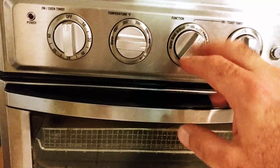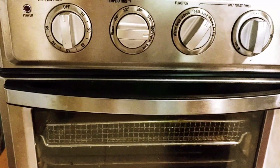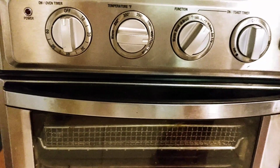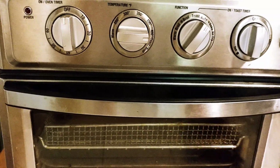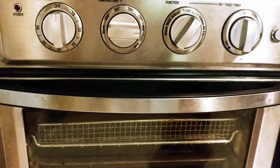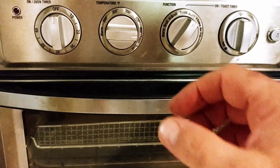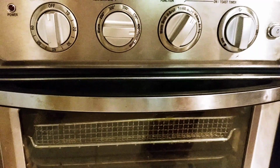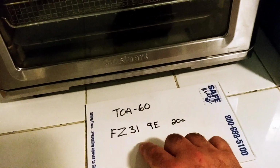All the other switches in here visually looked a lot more robust than the switch that works this. So there's two switches in a row here, actually, two identical switches. And I took the ball detent out of the broken one. You can tell that the ball detent had also knocked some stuff off. There's these little rockers in there, and they got knocked off their springs. I tried to put them back on the best I could with my screwdriver. I didn't really feel like waiting for this, so I'll order a couple of these switches.